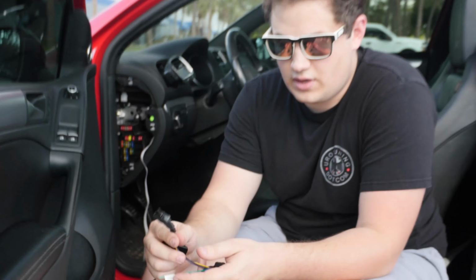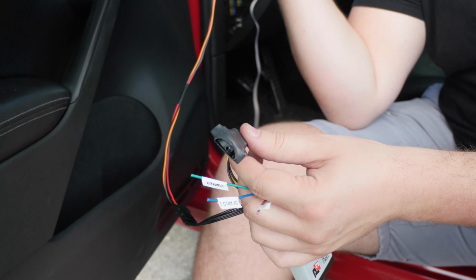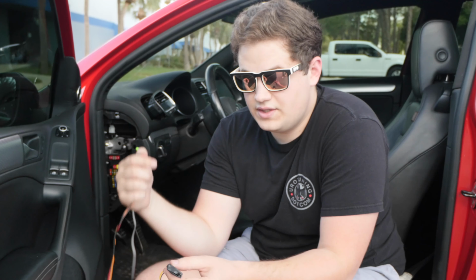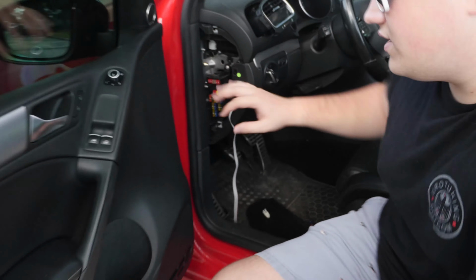And here you'll see this is our boost tap. Like I said, I got a boost tap. We're not going to hook it up today, but really all you do is you tap somewhere that has vacuum in the engine, run it through the firewall, and it'll slide right onto this little nipple, and then you'll start reading actual boost as opposed to reported boost through OBD. So now we're just going to finish installing this. It's super easy. We're back inside the car here.